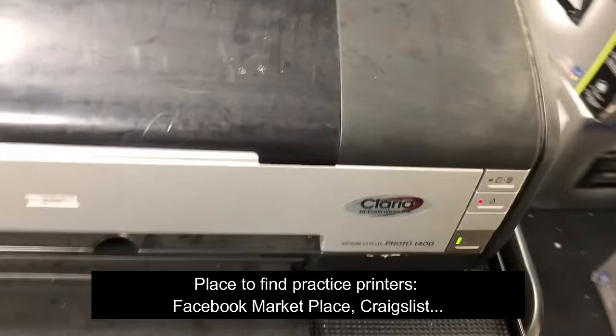Okay, now it's the hard work. Put a new pad on, and then bring out the titration tubes. There are two pieces of tube, so you cut a bigger tube. Then you slide a little bit of the smaller tube inside the large tube. Confused? Okay, it looks like this. So you got a bigger tube, and then if you see the top of it, you got a piece of small tube. And they fit each other nicely. So the small tube is to fit the ink intake, and the larger tube is for holding the ink.